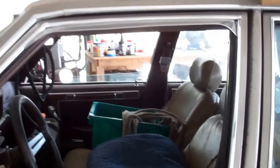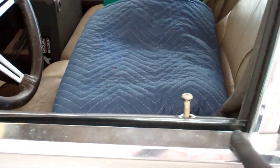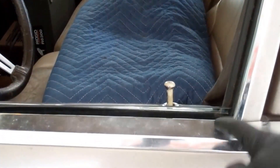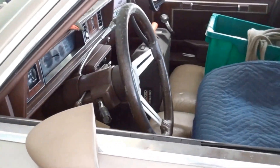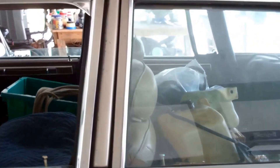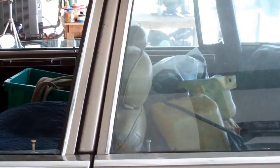These frames do not fit the openings that are made for them, and you're just going to simply have trouble with that. You could cut them out, but here's the thing: you measure from here down — not on the chrome here, but down where the window is up to here. On either side you're going to get different numbers, which of course leads to different angles, which leads to it ain't going to fit. Get as close as you can, tighten it all up, carry on.